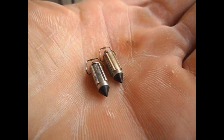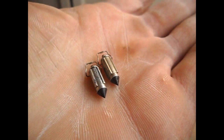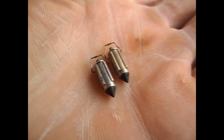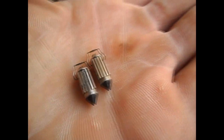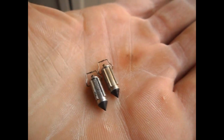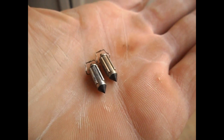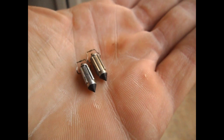They're as clean as they're going to get now. You can see the one on the left has some pretty bad pitting from the oxidation that I had to use the wire brush on. So yeah, I probably need to rebuild these things. But this is actually an extra set of carbs I have, and I'm only working on them so that I can get a second bike on the road while my first one's under repairs. Next up, we've got to check out the little passageways for the pilot circuit in the carb to make sure they're clear.